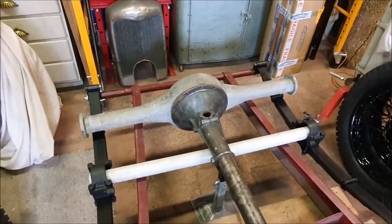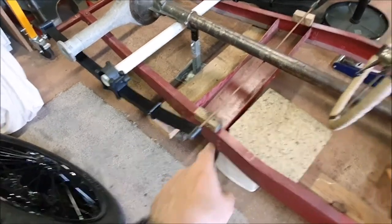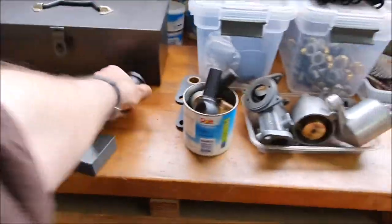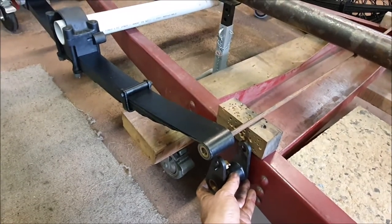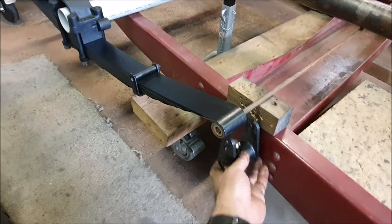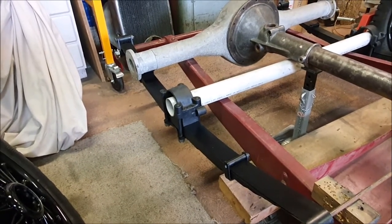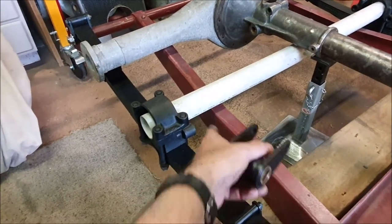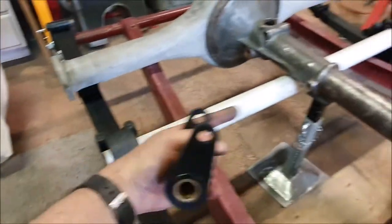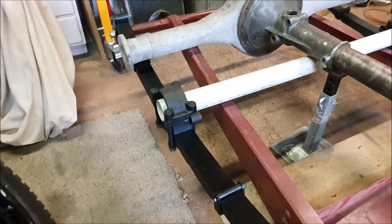It's lining up really well now. I need to figure out exactly where the shackles go at the front — I think the shackle pin is on the centerline of the chassis. The chassis goes under the axle, so the shackle has to be high enough that the axle will fit through those trunnions. It's looking pretty close, but I can't put the axle in place at the moment because the torque tube is in the way.